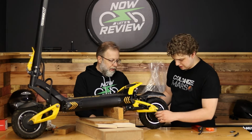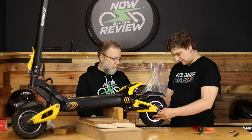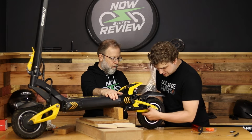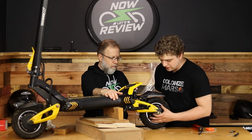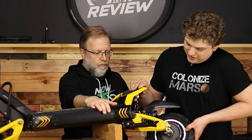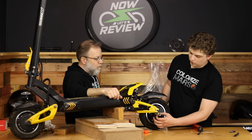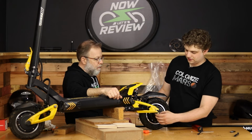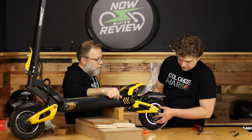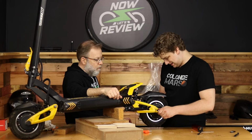And we got to get our brake caliper in there. Or brake rotor into the caliper. So, just going to get everything kind of aligned. And I think I'm going to put the motor wire back into its little holder and tighten that up before I go too nuts, because you do not want the motor wire rubbing against the wheel. The way it went on last time was we had the washers with the little lock things on the outside and the washers on the inside. So now I'm going to lift our motor into place and try and get everything hunky-dory here.